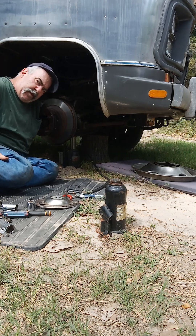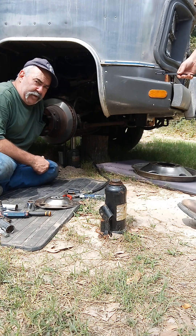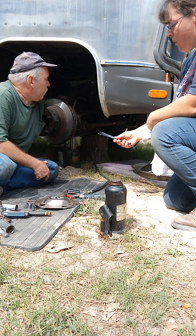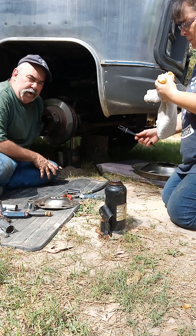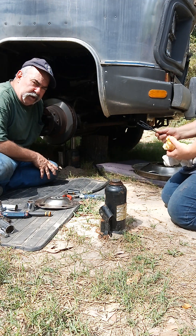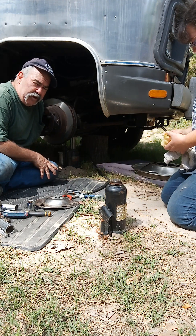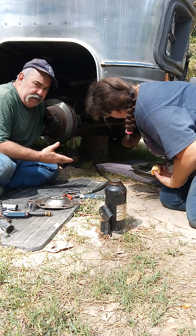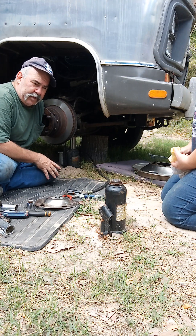What we're doing right now, if you can see me, is we're routing our fuel line and our fuel pressure regulator so it doesn't get too much fuel but it doesn't not get enough. You want just the right amount — four pounds of pressure to the carburetor. So we're mounting that up above the wheel on the inner wheel well instead of above the exhaust manifold, because if you have a junction of fuel line to anything, any kind of a junction, it will possibly leak there over time. And if it does develop a leak, you won't want gasoline leaking onto your hot exhaust manifold that may get up to 1,200 degrees, 1,100, 900, 500, 600 degrees. The exhaust manifolds get smoking hot and you don't want gasoline dripping onto them, and then any little spark that vaporizes gas will have a fire under there.